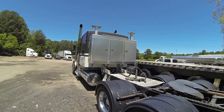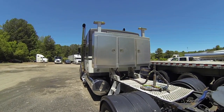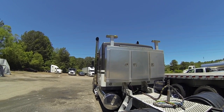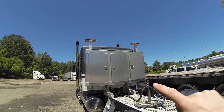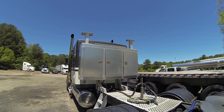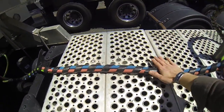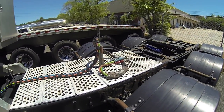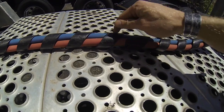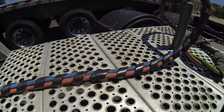The center box has bungee cords and two lawn chairs, with spare hooks for our chains, spare clevis pins, and cotter pins. Up top, the oversized load lights are Hella mini light bars - either 200 or 2000. The big light bar across the center is an AutoFeel 52-inch spot flood combo, which we use if we have to work on anything at night. On the air and electrical lines - yes, it is against DOT regulation for them to be touching the catwalk. However, the ones here have a plastic spiral wrap around them that prevents contact with the catwalk, which makes it legal - that is why they were designed that way.